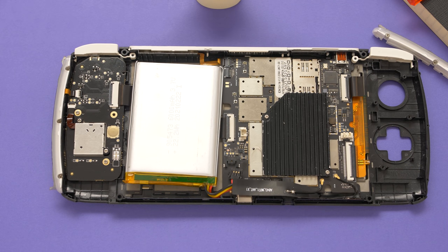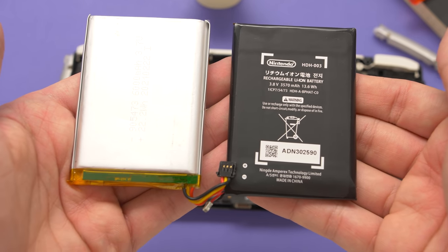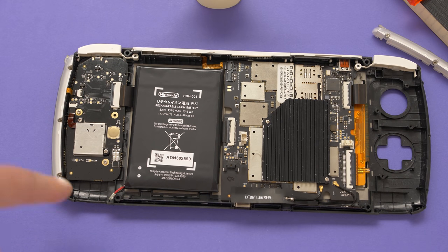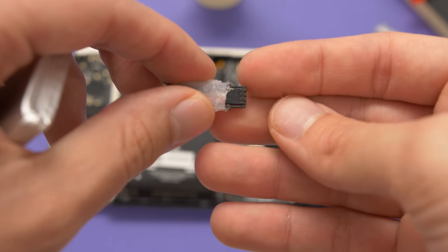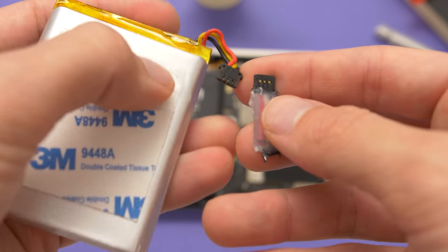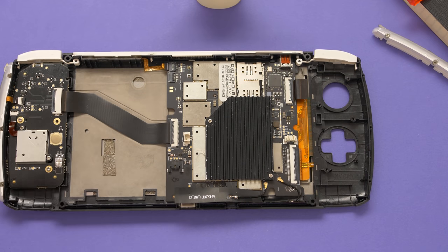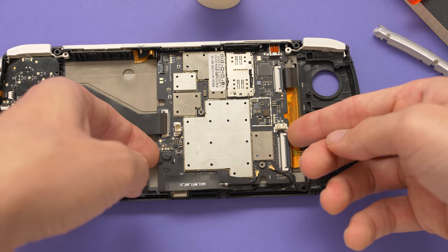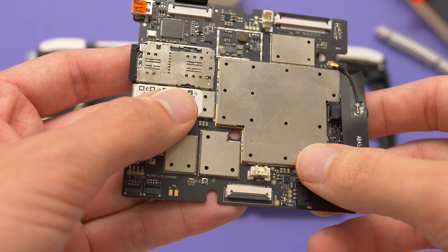Here we have the battery — this would normally be attached with adhesive, but I can remove this easily on this prototype. The shape of these batteries is basically the same, so this battery can fit into the shell with no problem. The only thing you would need is a connector long enough to reach the normal battery port. I have a crude prototype adapter that takes the Switch battery plug and adapts it to fit inside the battery port on Odin. We don't have much left to free our main PCB — we have another flat panel connector for the top buttons and another connector for the other controller board that sits under the battery. We're going to lift the PCB up, unhook the display, and remove the WiFi cables.